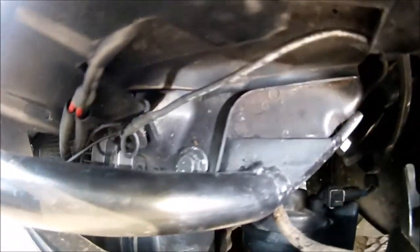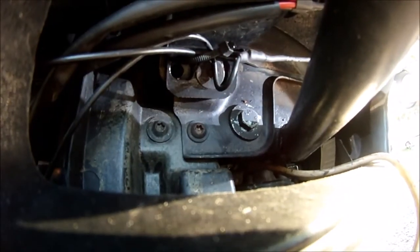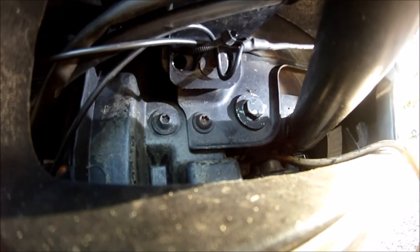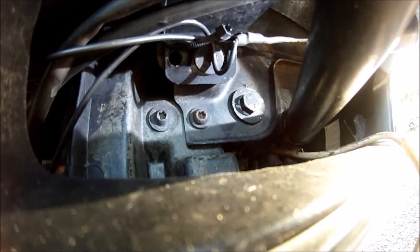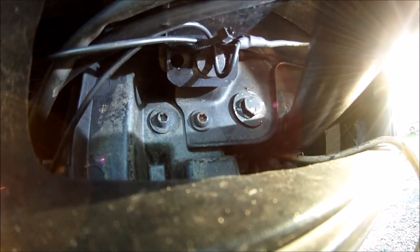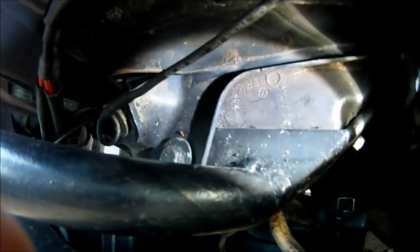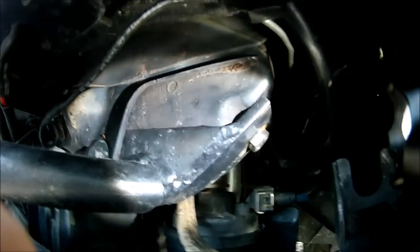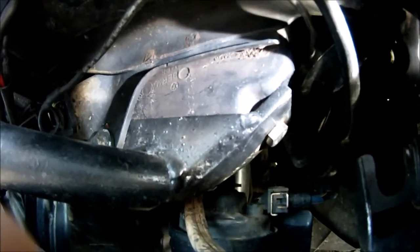And then for the other hole, it's the radiator support bolt. I don't know if you can see it in there. It goes behind that flange, so you have to loosen that with a 13mm socket, pull that bolt out, and then that, I think it's a 25 Torx, has to come out, or at least be loosened. Then I get a screwdriver right in there by the Volkswagen symbol, pry back, and that piece will slide right in, and that makes it more sturdy because it's got that nice heavy flat plate to push against.